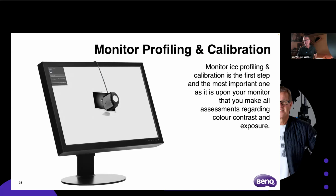But there's a couple of things that we need to take into consideration. The ICC profile, when we create it, there's just a couple of settings that we need to be aware of in order to make sure that we are setting the monitor up for photography, because videographers use these monitors, designers, and they all work in different color spaces. So Adobe RGB is an ICC profile, but it's also what we call a color space. So it's a space that contains a certain amount of color that we can work with. And I'm going to go through and just demonstrate some of the things in Photoshop shortly to show you what I'm talking about.